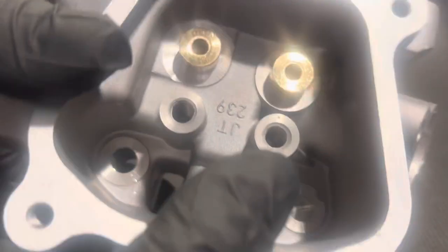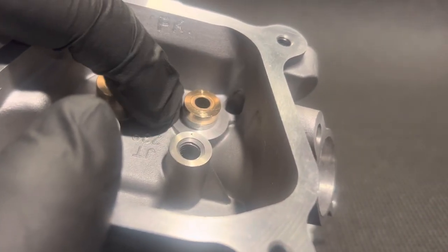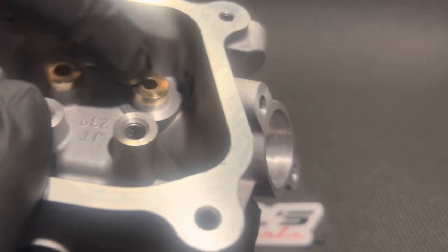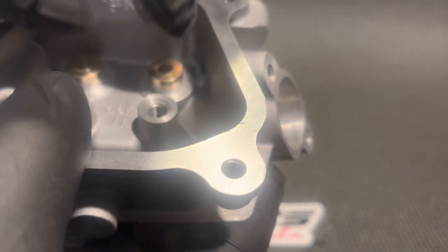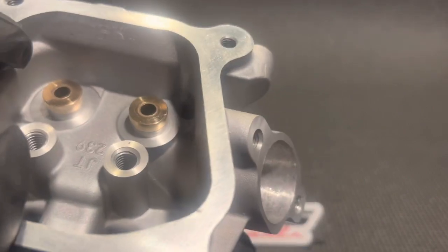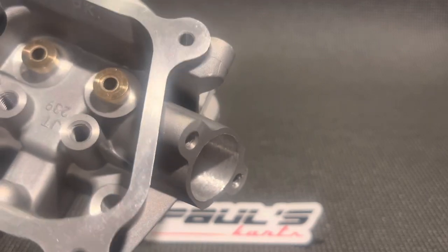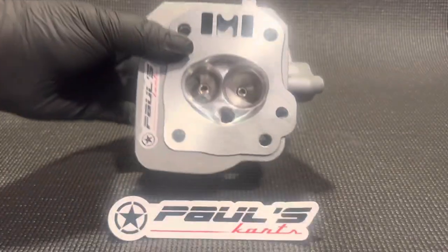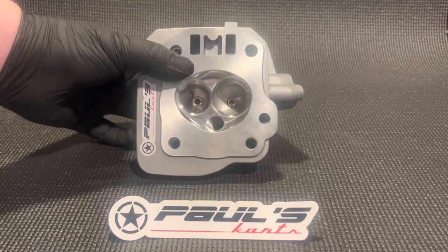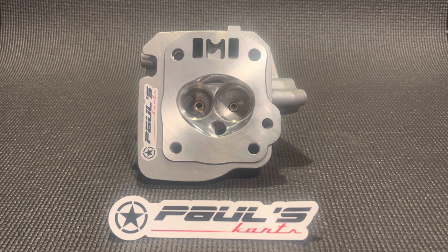Bronze guides. This has the bronze guides with the head on them. The head prevents fall-through. It also locates the inner spring on the dual-coil springs, and gives a little bit more stability to the valve guide — especially when you get in there and you get some big ports. This area can get really thin, and when it gets hot it can distort. So having a little bit more meat, basically like setting up a tripod, having a little bit more material there to sit the guide on gives a little bit better stability.